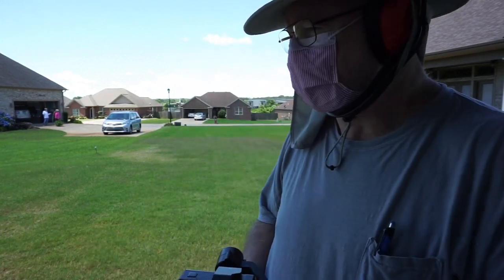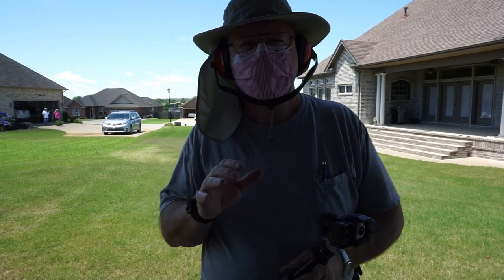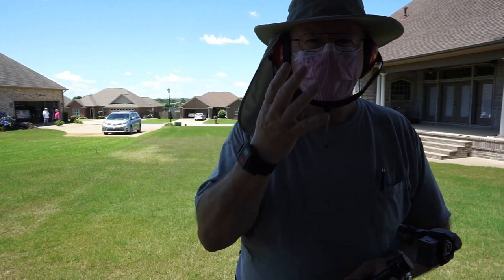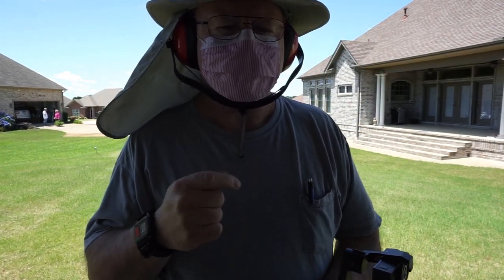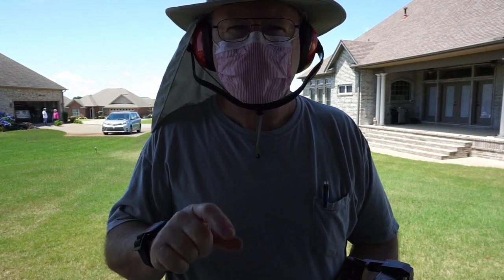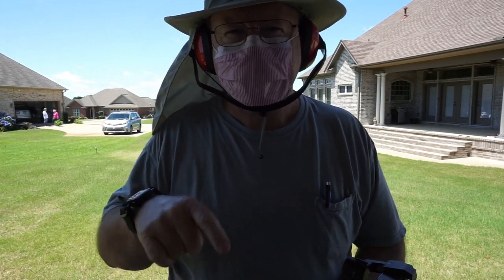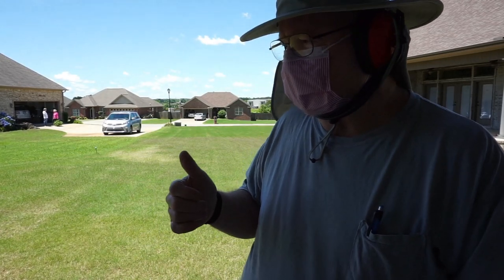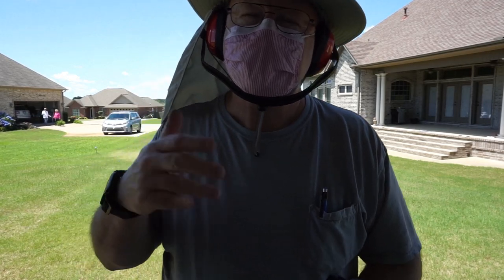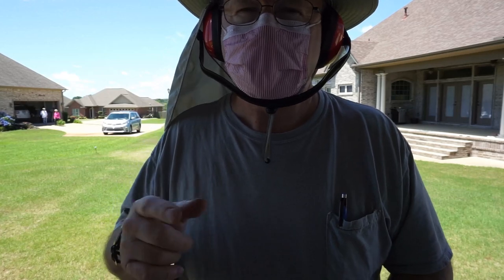We're going to do a little bit of a photo shoot real quick with the Hustler Raptor deck skirting. And on the left side of the skirt, left half, we've raised the deck to 4 inches. We've dropped the skirting to 1 inch above the ground. So that's going to have 3 inches of blockage around half the skirt. On the other side, we're going to run it at 1 inch. Well, actually, I take it back, 1 inch of blockage below the deck skirt.